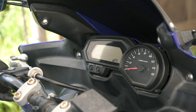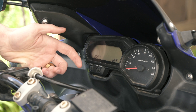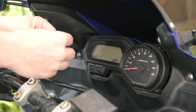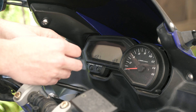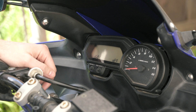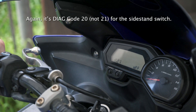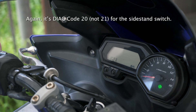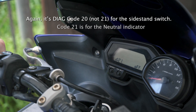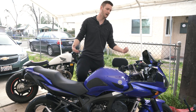This is a very common issue for these bikes — Yamaha apparently has this issue in a lot of different sport bikes, the side stand switch malfunctioning. In my case the switch itself works fine, it was just the connection. I disconnected it, cleaned it out a little bit, reconnected it, and the code 19 went away — a stupid easy fix. To test it: with the kickstand down and in neutral it reads correctly, showing off and on. Put it in first gear and it goes back off, meaning the bike won't run if it's in first with the stand down.